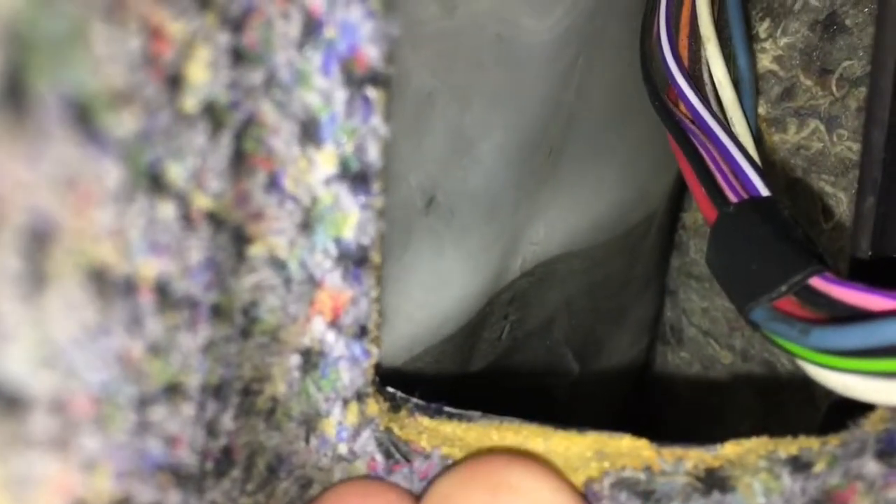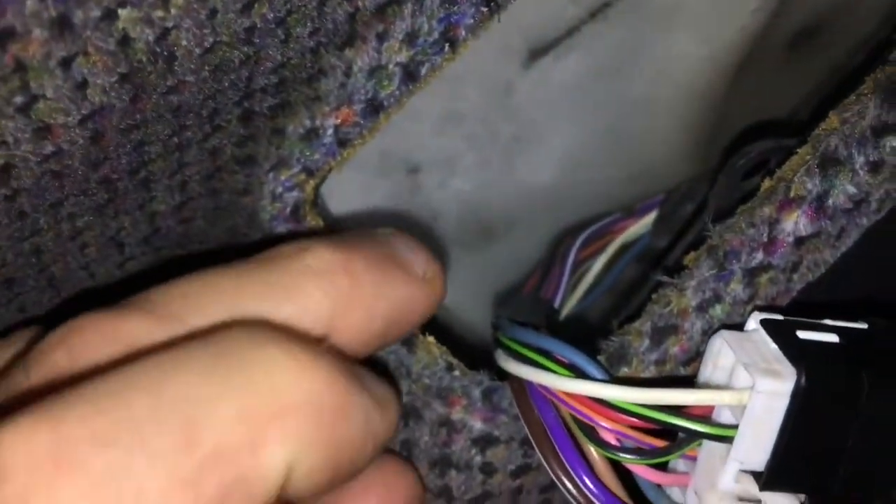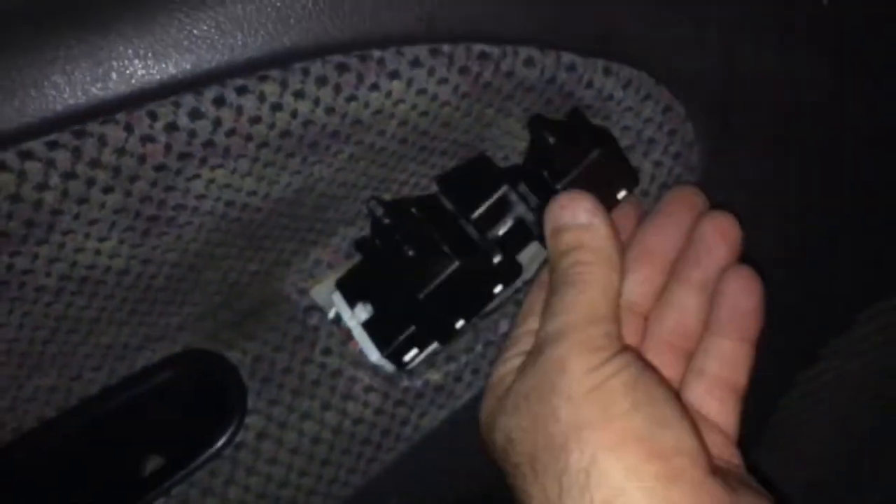You don't want to go in and out of this hole too much. This is upholstered over a piece of hard plastic — about an eighth of an inch thick. It's pretty hard but it's got a little groove where the clip has been biting in. How you would put it back in is tail-first with the whole switch assembly, then push it in because you've got to get through the wires in there.